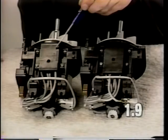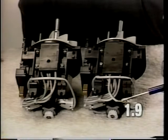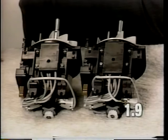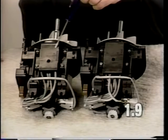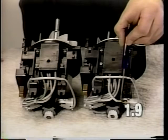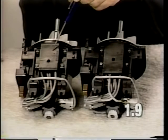Two types of EMI filters are used in some international markets. There is the 4-wire and there is the 5-wire. The 5-wire uses a static discharge wire which attaches to the left rear motor mount screw. The 5-wire also has a longer circuit board and cover. If you do not have a 4-wire circuit board available, you can adapt it to a 5-wire by changing the circuit board, the cover, and adding the static discharge wire. Do not change from a 5-wire to a 4-wire EMI filter assembly.